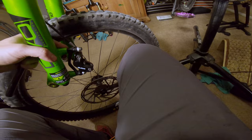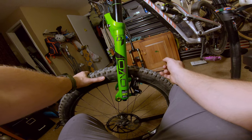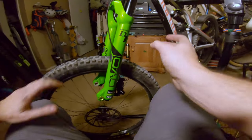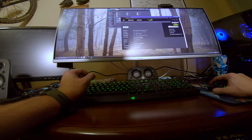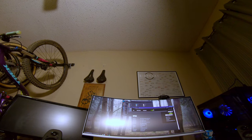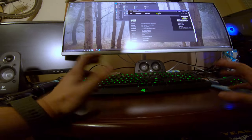Why is this not going in at all? This is for a 160 millimeter rotor — I bet that's it. No, we have to go online. That's my fault — the fork has a 160mm rotor mount and I have 203s, so wrong adapter. Well, that's for another day.